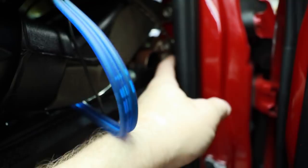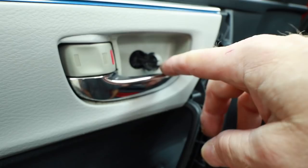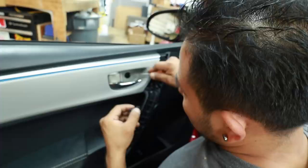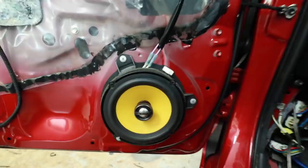We're also concerned with the fact that the boot is not in place. Then I have this silver wire here that seems to be going into the boot. On Fernando's side, the screw cover apparently broke, so there's just a big ball of strip caulk in there — you can smell it. We're going to have to pull that out. With the door panel off, we can get a better idea of what's going on. Here's the boot — wire just pulled through it. Pretty sure water's getting into the car here.